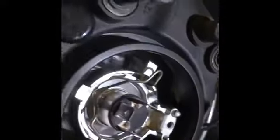Taking the head off, it's actually really easy. You'll be surprised how easy it was. And then I just detached this connector here, which connected to the old bulb. I'm just going to take that old bulb out and stick in this LED. Let's see if I can do that now actually. It was plug and play, easy. And I'll turn the bike on.